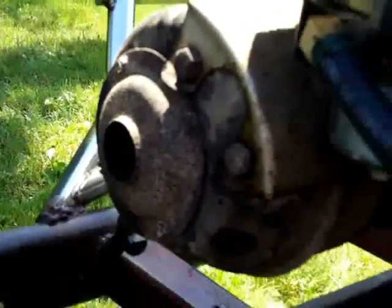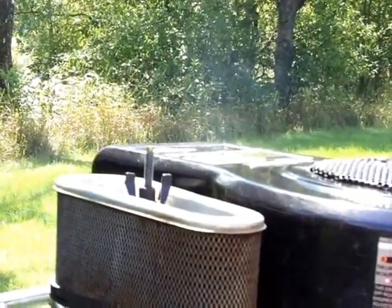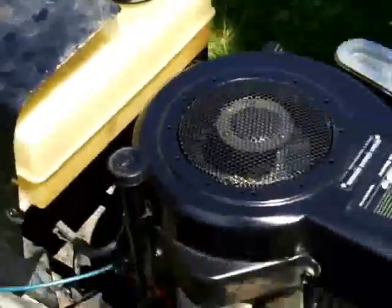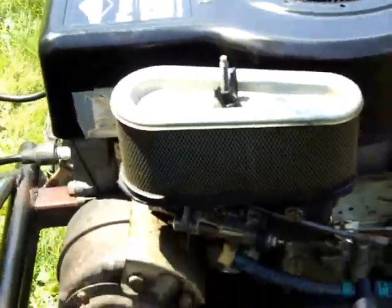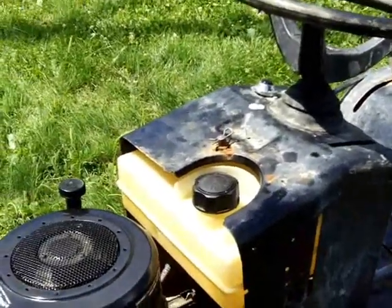She's smoking a little bit still, but it seems like everything's running really good. I'm going to double check the oil, make sure it's not just eating oil as we speak, and basically consider it done. Thankfully I can shut the fuel off — running out of gas when I shut it down, so there's no fuel in the float bowl anymore when it sits, which will be beneficial. Yep, all done — oil change, fuel line, new fuel, clean fuel tank, and shutoff. Probably going to replace that air filter, but that was like $13 and I didn't want to drop the coin on that right away, so next time. Thanks for watching, I'll keep you posted on that next video.